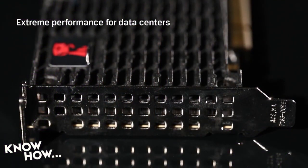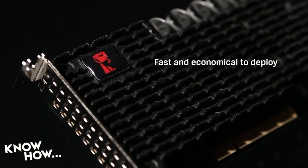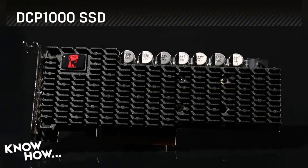So we've got IOPS and bandwidth in this product, right? From an IOPS perspective, these are IOs per second. In databases, IOPS are very, very important. If you're running high-performance databases, we want to be able to deliver storage that has a high transaction profile. And that's what we're getting with an NVMe-type device. In the client space, we're not really too concerned with IOPS. We don't need them there. We more need the sequential throughput. But for server applications and running databases and transaction processing, we need high IOPS and low latency.